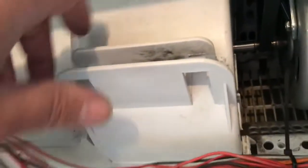So with a bit of wiggling, the important thing is to get this clip on this side, and also when you look at it down this side, there shouldn't be any gap around here, so this should be nice and tight. And then it just kind of locks in place there. You just push it down and make sure those little lugs sit underneath this, and then that's kind of in place. And then remember where we took out the wiring, we just need to pop this wiring back inside these clips here.